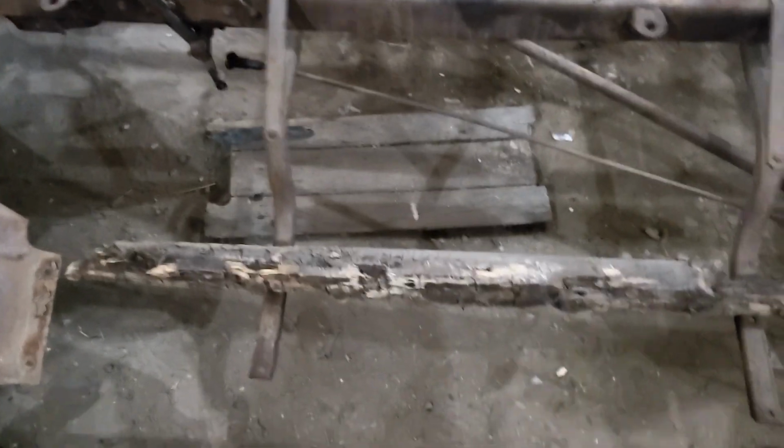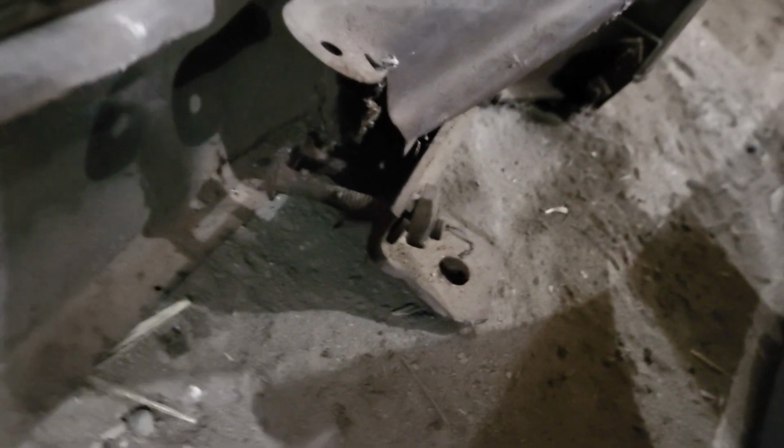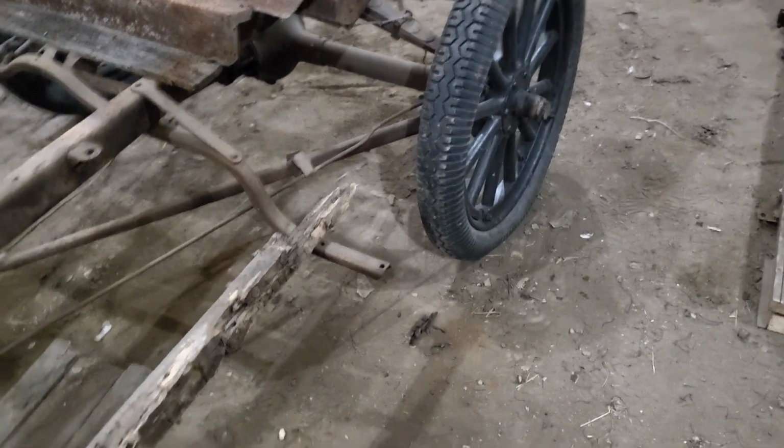So either they were out of them that day, or Buddy had to go to the bathroom as it rolled by on the assembly line. So anyway, we'll blame the entire failure maybe on that. I was just going to look here in the front. Yeah, there's no doubler in the front either. And yet this one has a doubler plate front and back where that body mount is, where it mounts to the frame. So that is interesting. That got missed. QC was just on holiday that day.